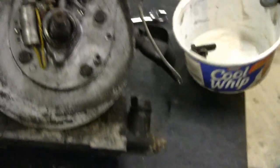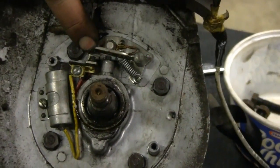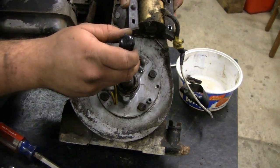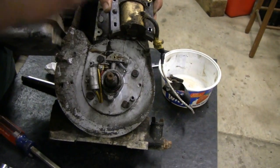There are the points — how do the points look, Mike? Don't forget, we're just trying to get this thing running and see if it runs before we do anything to it. It doesn't fire. I need a smaller flat head to pull that off. I just happen to have the condenser checker right behind us here.